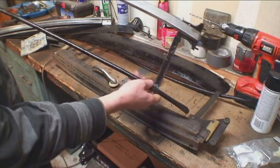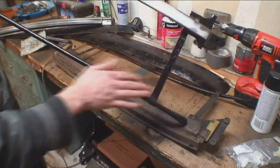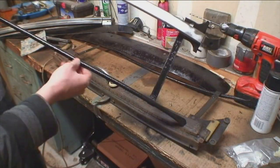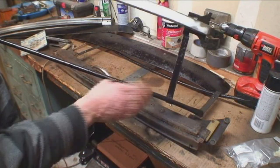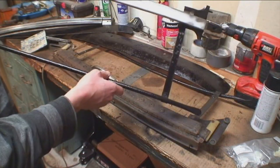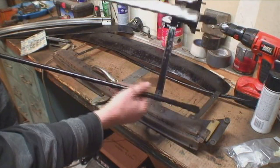We started painting these black and polished off the aluminum a little bit. Started painting the bows and all of this black, so when you spray the spray glue on there it'll just adhere better. Before you spray, sand it down a little bit to get some of the loose rust or dirt off, then spray it black.